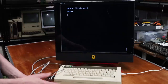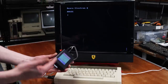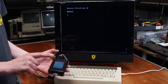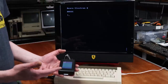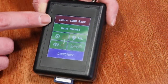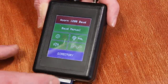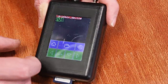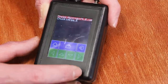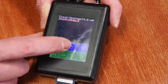Let's take a look at some of the options we've got for loading software onto this machine in modern times. The first is obviously a cassette emulator — this particular one is the SVICas. It's the older version; the newer one in a white case actually has a lot more functionality. They're pretty simple to use. Here is our SVICas — I've already set it to Acorn. You can change computers by simply tapping this. Everything else you can pretty much leave as standard and we simply go to directory. I've made an ELK directory on the SD card — go in there. That top version of Chuckie Egg doesn't actually work, but I can go and bring up Chuckie Egg.